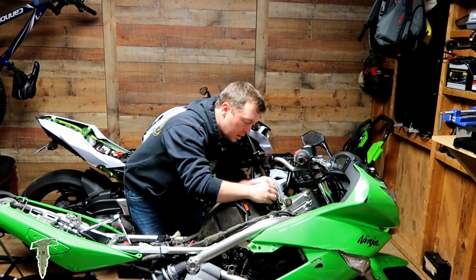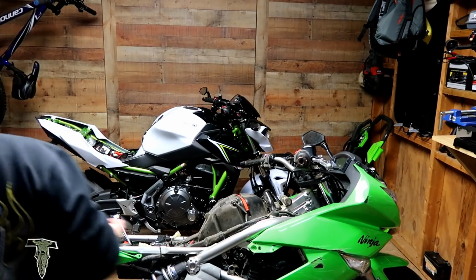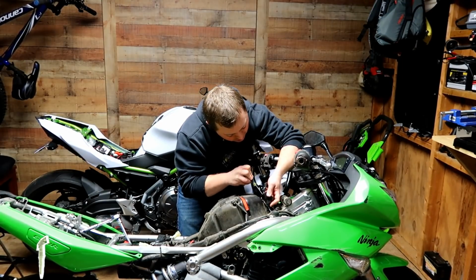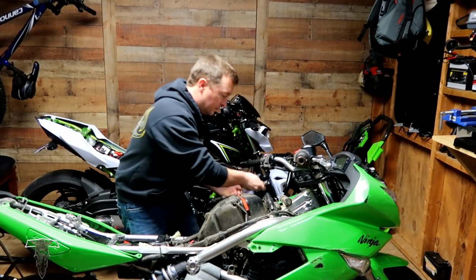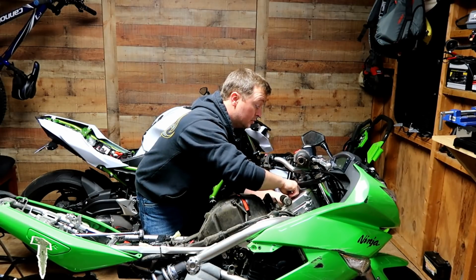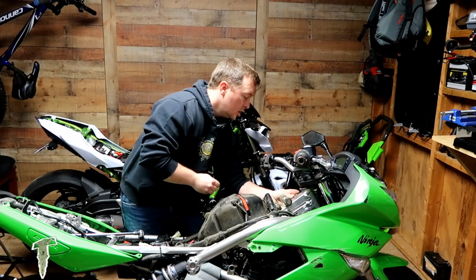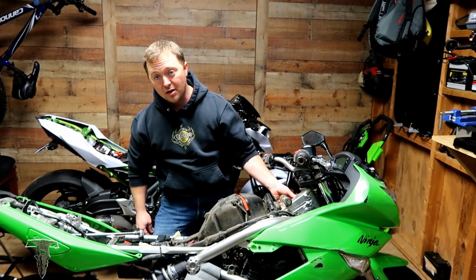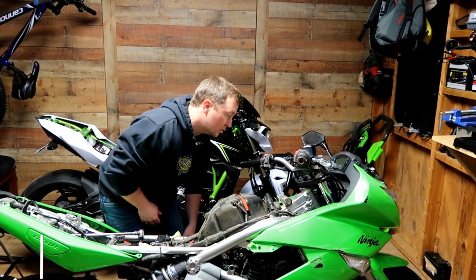So this connects here. Yeah, I'm going to need some assistance on that one. And I have a terminal screwdriver. And that's that. And we need the 10mm again to get the wiring harness connector loose. And I went through earlier and checked all the fuses on this bike. And there's the ignition, the old one. But I found one blown fuse, and that was on the starter relay. And they had put a 75 amp fuse on this thing, and then apparently blown it, probably hooked jumper cables up backwards. That's generally what will happen.